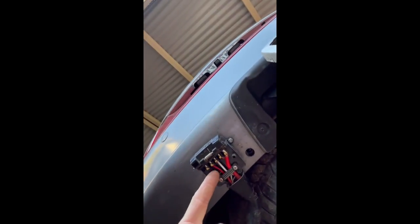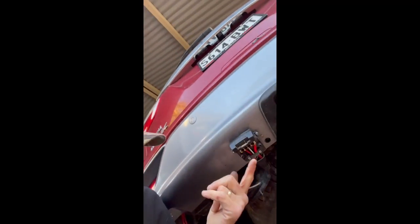Number one, it's not even in the right pin. Number two, it's split, so there's constant power going to both pins. Pin 12 is the AES trigger wire, pin 11 is brake safe charging, and pin 8 is that thin cable, and pin 10 is supposed to be a nice thick earth — it's not done right. The wire's been split, it's the wrong one. That needs to go to the high current side because that is the high current wire. Pin 10, the earth return, needs to be the same gauge cable, and it's not — they've just used the factory white wire, which is very thin.